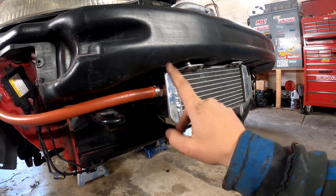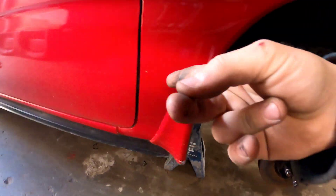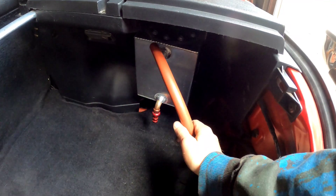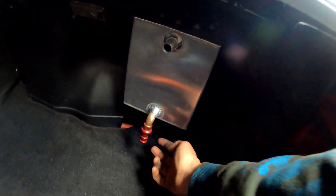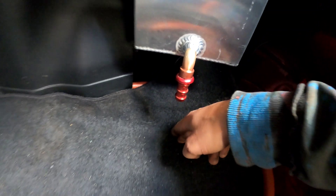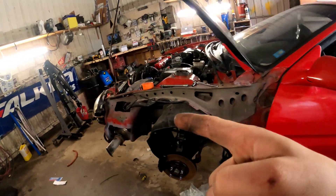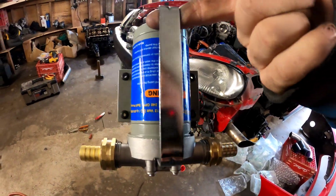I got the outlet done for the rad — it goes through here, up into the wheel well, down underneath the carpet. Actually turned out really good, can't tell at all. I've got the hose out to here but I'm short a couple of fittings, so I'm going to do those last because I'm waiting on a bag of them. I want to 90 out of here and then straight down. Now I'm going to do the outlet from the water box, drill a hole, go underneath the car, then mount the pump and run it towards the front on the driver's side.